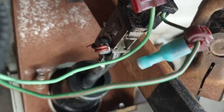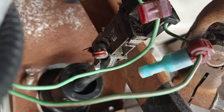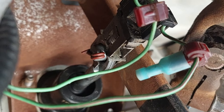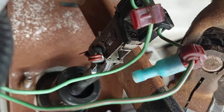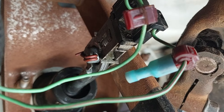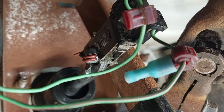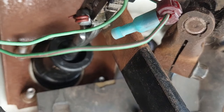Got it all back together after tightening everything up. When you go to install the brake on-off switch, the outside part of that switch is a half circle and the inside is a full circle. You have to slide the brake on-off switch onto the post on the brake pedal first. Then, before you slide it too far, you have to swing up the ring from the brake booster and slide that onto the post, snugging it up in the middle of the brake on-off switch — all kind of in one move. Once you have that done, slide it all the way in until you can see the hole at the end of the post, slide in your retention pin and hitch pin, and you're good to go. Brake booster installation is done on the inside of the cab.